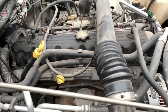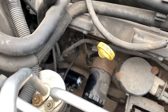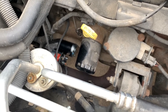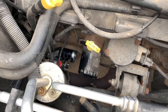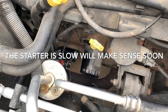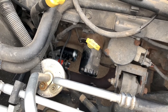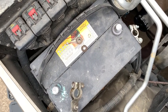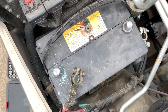What happened to your Jeep that started all this? It just went click, click, click, click. So I thought it's got to be the starter — but it may not be the starter, so I might be replacing it for no reason. I did have it tested at the auto parts place and they said the starter's testing good but it's slow. Do you know how old your battery is? This battery was a refurbished battery, so it's probably at least two years old.